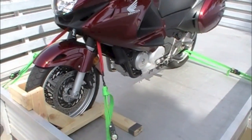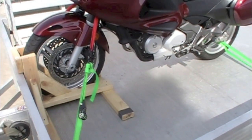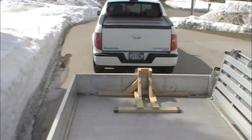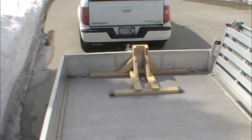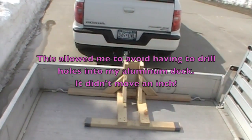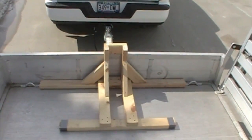I'm going to talk about the wheel chock design. I looked at a number of photos online and figured out the best way to hold the motorcycle to keep it from wobbling side to side or sliding. Looking at it without the motorcycle, at the front of the wheel chock there's a longboard that's 54 inches long. I cut it longer because the two tie-down loops welded to the deck of the trailer are spaced so that board fits right in between them, keeping it from sliding side to side. I wrapped some duct tape around the back board to give a little extra grip.